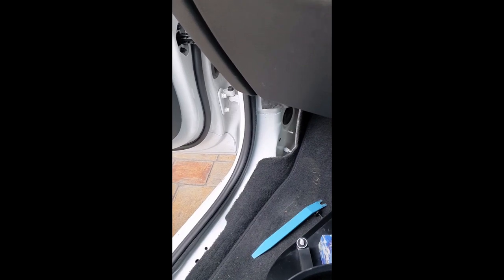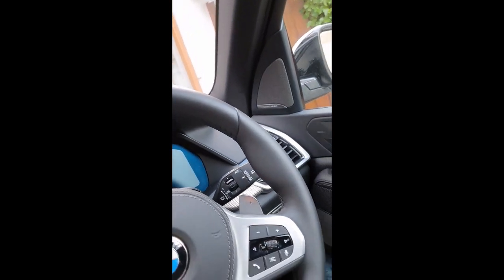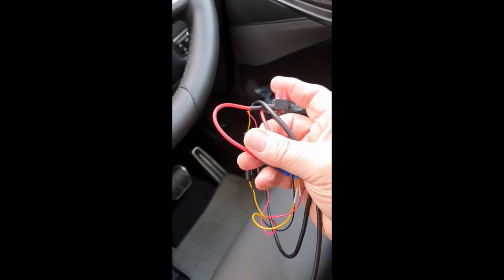I've been taking all that lot off on the left hand side hoping to find a front fuse panel. I couldn't find it, so I've decided to take option B, which is going to be to run the rear view camera from up there and then run the power lead across the top, above the mirror in that recess around the top, and extend the power lead lengths and run them back to the rear fuse panel. That's plan B — see how we get on.